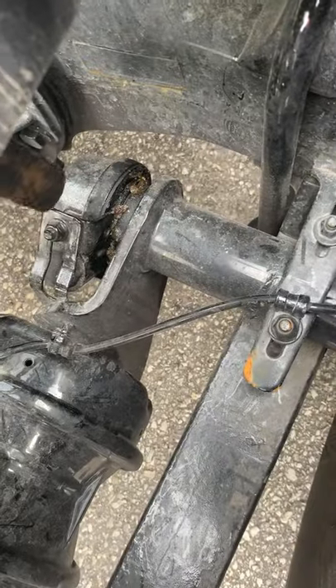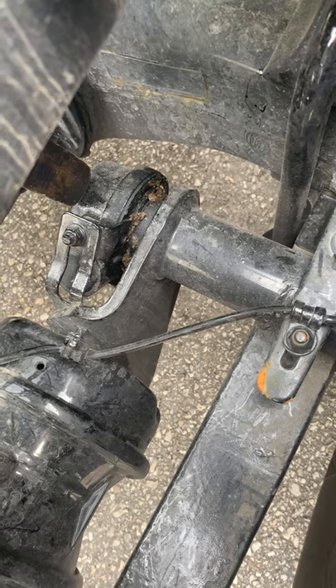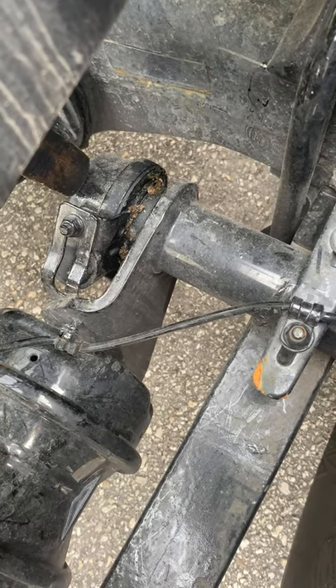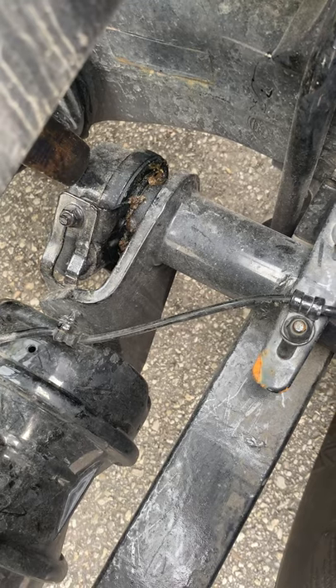From there you're going to go to your slack adjuster. Your slack adjuster is properly mounted and secured to the push rod with pins and keepers. With brakes released, the slack adjuster travels no more than one inch. If it does, have it adjusted before the trip.